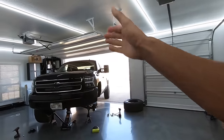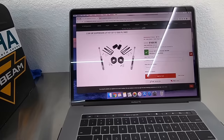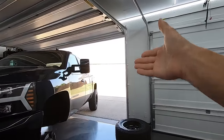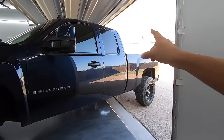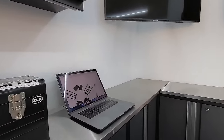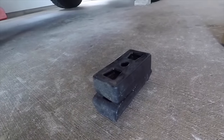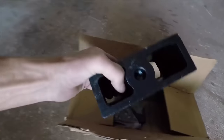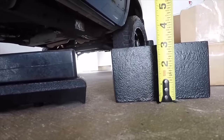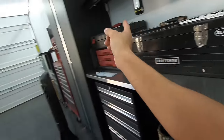These three and a half inch spacers basically bolt on to the top of your strut and lift the front end of your truck three and a half inches. Doing so puts awkward angles — we'll talk about that in a little bit. In addition, it also comes with blocks in the rear to level the truck. Because if you go up three and a half inches in the front and leave the stock blocks in the back, you'll have a California squat. So they give you a one to one and a half inch block made of hard plastic to stack on top of your stock cast iron blocks. Stacking blocks is highly advised against on off-road trucks. So I ended up buying Pro Comp 3-inch blocks for the rear — three and a half inches of lift in the front, three inches in the rear. In addition you get the Rough Country N2.0 shocks, which we just tested. The shocks did great.